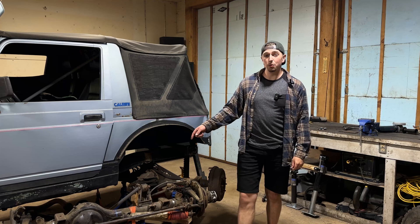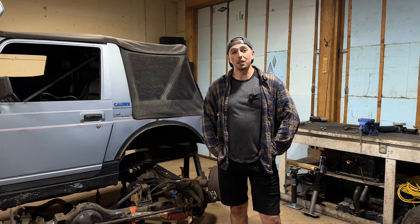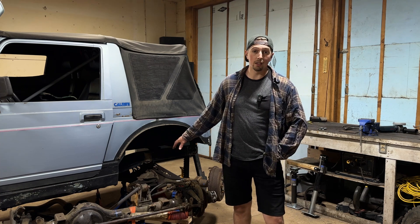I'm feeling great about it and today we're building a rear axle truss for my Toyota housing. On our agenda for today we need to start by cleaning up a lot of the stock brackets and mounts that come on these Toyota housings. We don't have any use for them and we just want a clean slate for our axle truss and our link mounts.